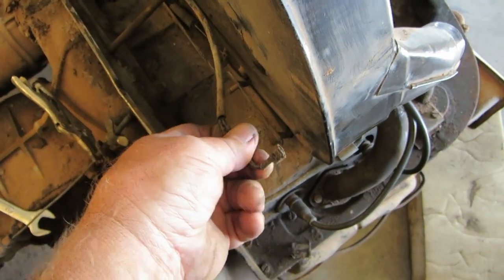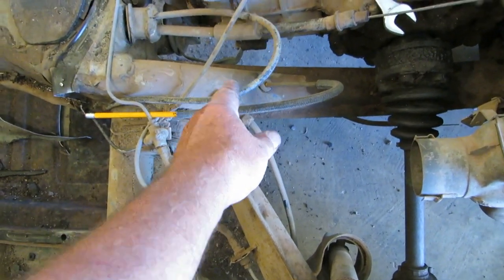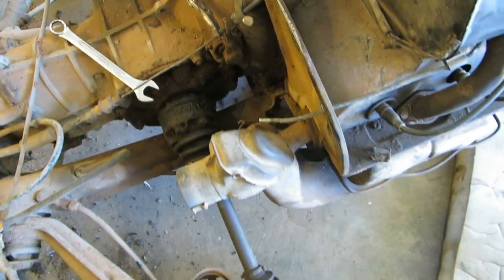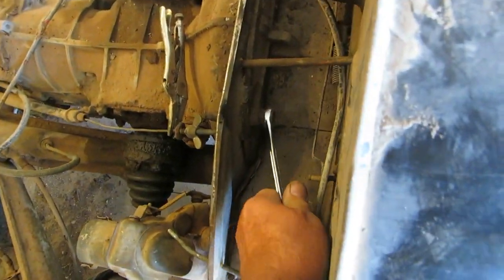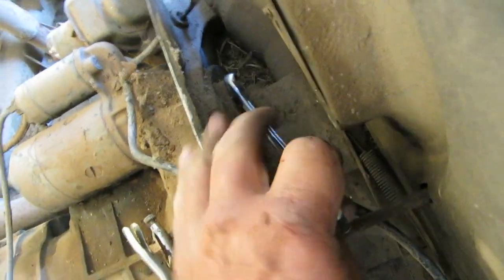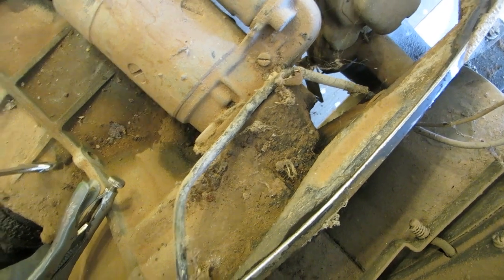You have some 17mm bolts here, one here, one here. Your starter bolt — if you've never had one of these out before — will come out the whole thing. Little things like this were lost on my '67. This has got a remanufacture tag on the starter, so the starter's been remanned. I don't think this engine's ever been out. There are so many things that make me think that — one being the absence of any 10mm head, 6-point, 6mm thread cheese head bolts that have been replaced. Even competent mechanics lose them and substitute a regular bolt. This one has all the originals.